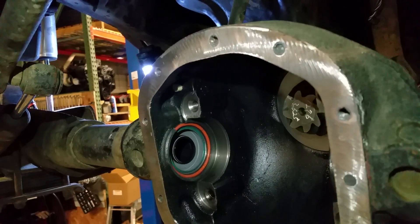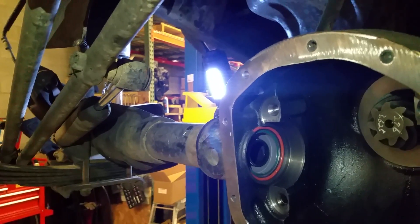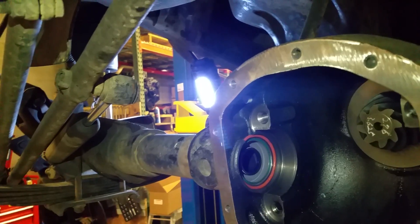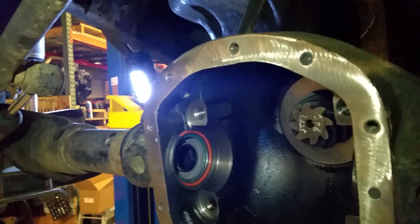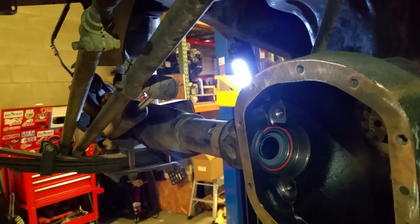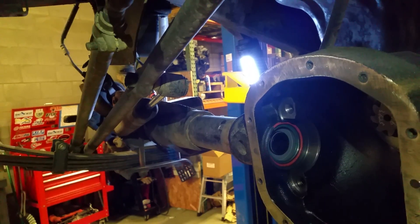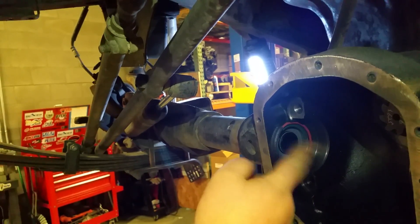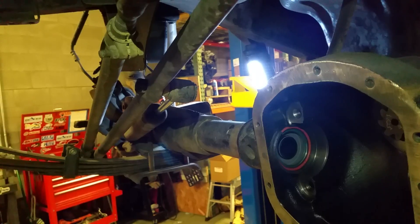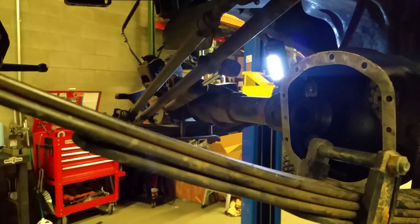Anyway, that's about it. I wanted to show you guys it's not as simple as just taking an axle out and putting a new one in. You need to do some block-off work here, and you'll need to pull the diff out — but you don't need to change your backlash or carrier preload since it's already set. Just disconnect, pull the bearing cap bolts, pull out the carrier, put the seal in, put everything back together, slide your axle in, and you're good to go. Thanks for checking it out — it's rockridge4wheeldrive.com. We appreciate you watching, thanks.